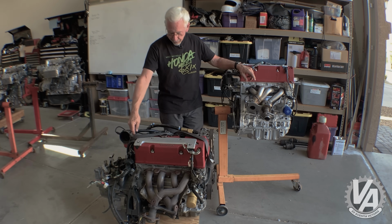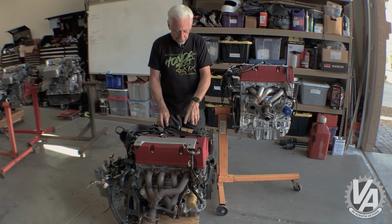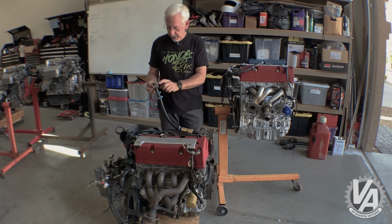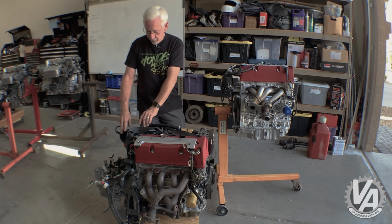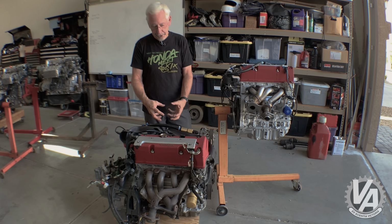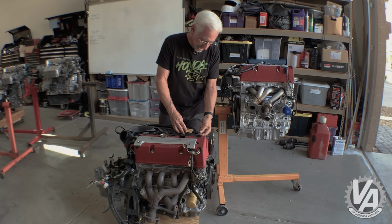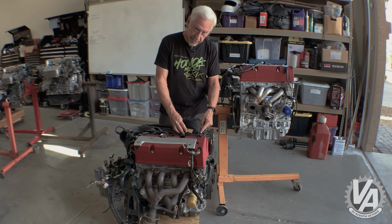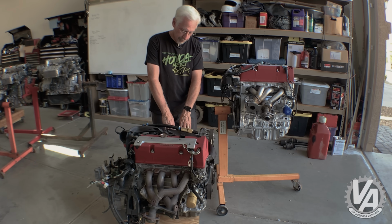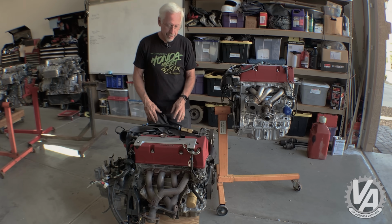It's connected up to the valve cover with a hose, and it looks like there's some valve work in here as well. So this would normally connect to the intake air tube, and use the velocity of the air coming in from the intake air tube to draw down pressure in the crankcases. And then when the throttle body is closed, it looks like it has another port here that might be connected straight to vacuum, so that when the throttle body is closed, vacuum from the intake manifold would then further lower pressure.